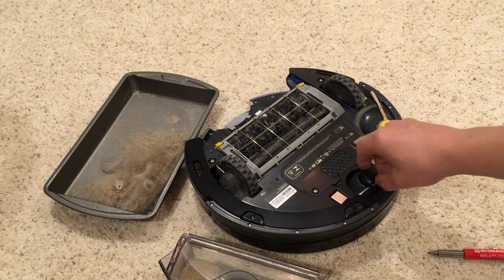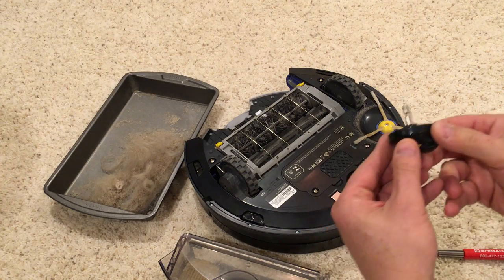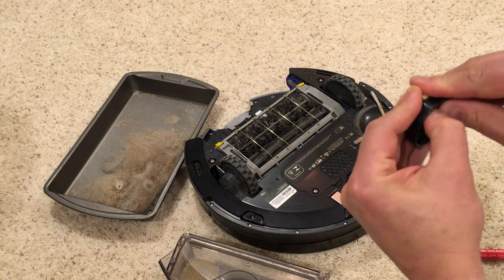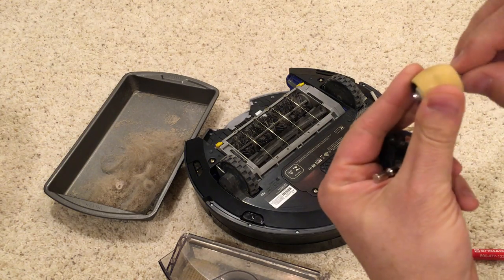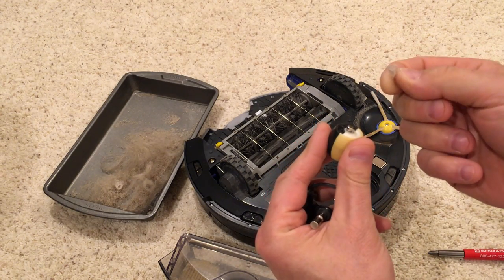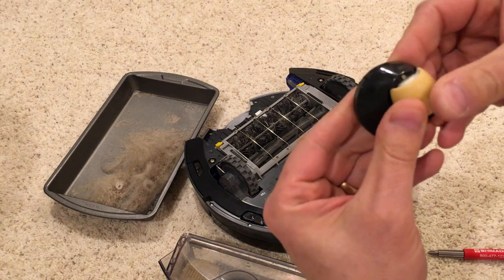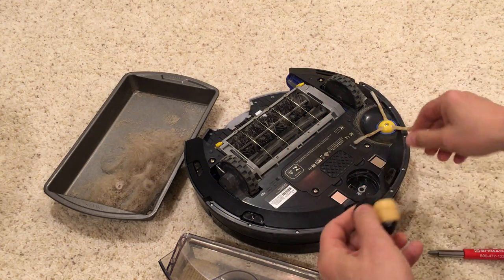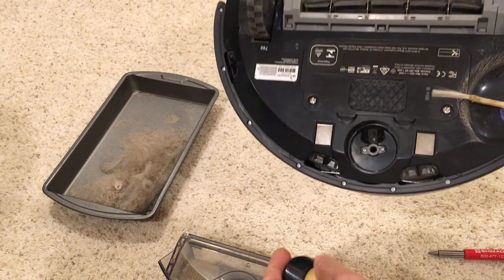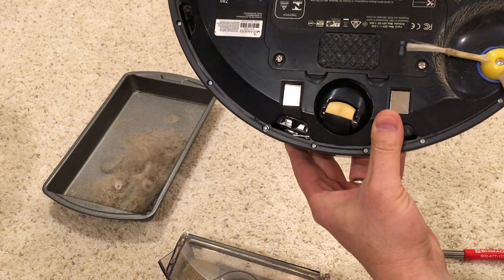I'm sure there's hair in here now, so let's take a look. To get this out, you grab the roller and pull it straight up — it looks like that. The roller sits in this little caster, and then you take your fingers and pop that out. On either side of the shaft there's more hair — you can see that right between my fingertips. Then to reassemble: this goes back in place, and you can see here where it plugs in. There's an optical sensor right up in the top there, and we just plug the shaft into that hole and push it in place.